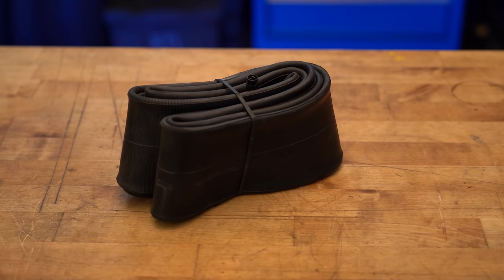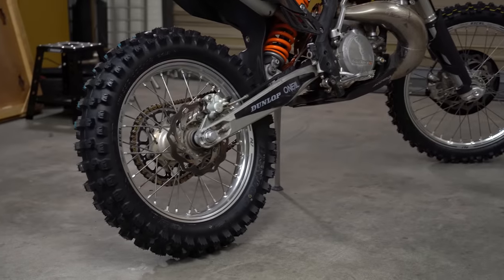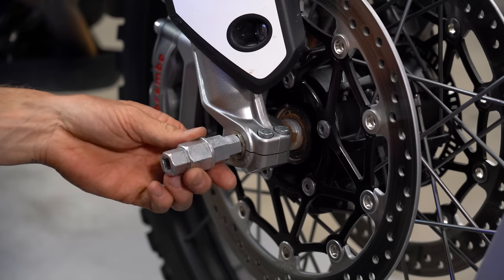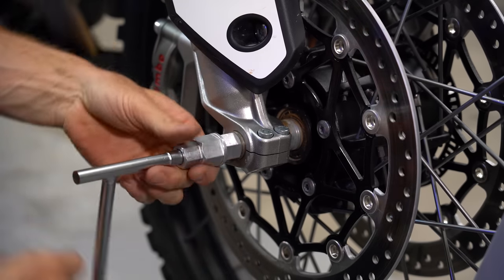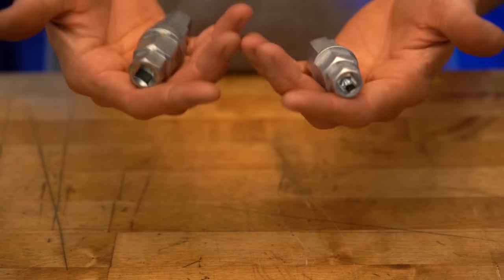And if you're rolling on tube wheels, pack an extra tube. For enduro and ADV riding, I'll carry a 21-inch tube since it'll work for the front or you can stuff it into an 18-inch rear in a pinch. For the front wheel, this combo tool will fit all internal hex axles, and you can spin it with a 3/8 drive ratchet or a wrench. They come in steel and aluminum, so make sure you're going with the latter to save weight. As for stands, I've had to get creative with a stump or logs or, worst case scenario, you might have to lay the bike on its side.